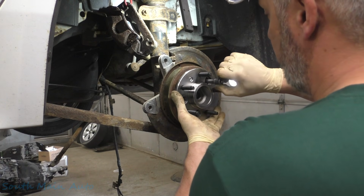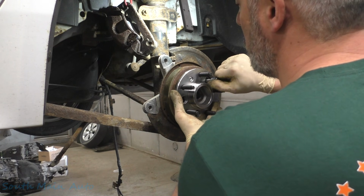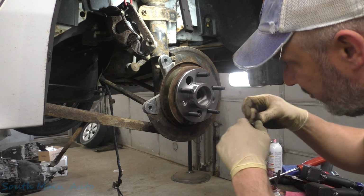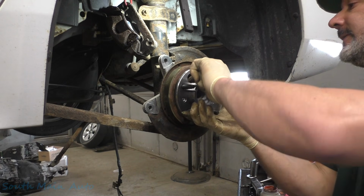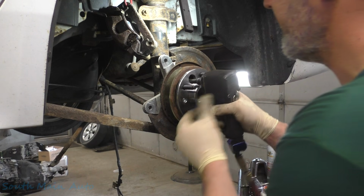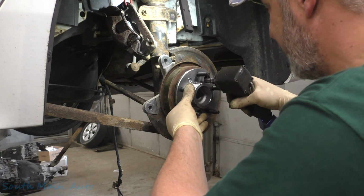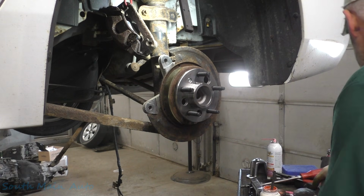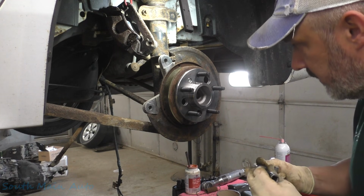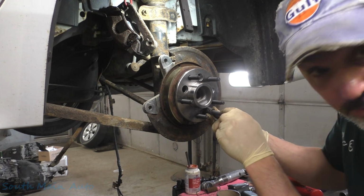Got a lady here with a Dodge Journey, came in for the inspection. Everything went good. Everything looked good. Boom, plugged it in, failed emissions. None of the monitors are set. And allegedly, she hasn't touched it. However, she did state that the engine light has been coming on and off. Goes on, goes off. Something to do with the thermostat, she says.